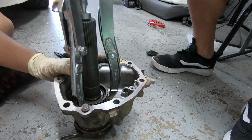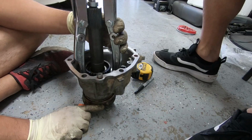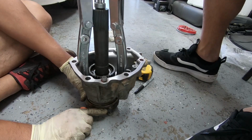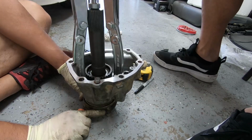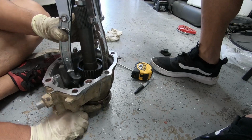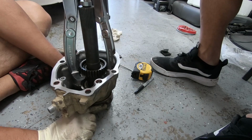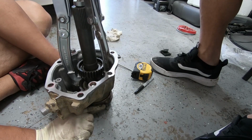The only puller that I found that was able to go into the extension housing with some light modifications is this Harbor Freight one. As you can see from one of the arms, I had to grind it down to make it clear, but it did work in getting the gear out. And I'll have a link to it in the description down below.